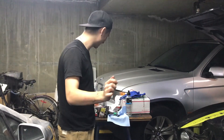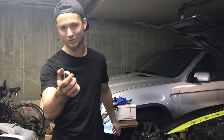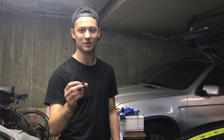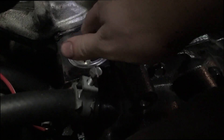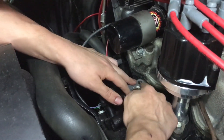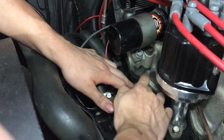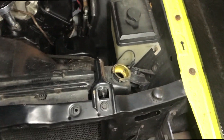I'll link the part number in the description — it's from Team Iron. Alright, thermostat facing radiator, going in now. Sits nice just like it's supposed to. Beautiful. I scraped all the gasket material away so I can put the new one on. Alright, got the hose back on, everything is clamped up, just gotta screw in the drain plug and start putting in some distilled water with super coolant that I'll show you in a second.